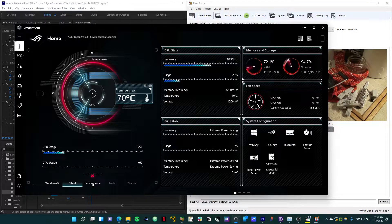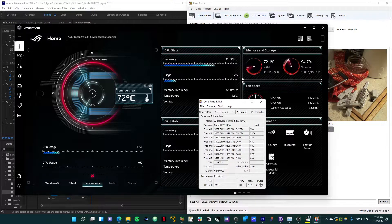If I wanted a little bit of extra performance boost, I could go ahead and put it on performance mode, and you can see it pumps up that CPU frequency and increases the power a little bit. Looking at CoreTemp now, you can see our power went up slightly — still just recording OBS — bouncing around between 19 and 27 watts. Essentially, when you adjust these settings, it bumps up the frequency, which then uses more power.